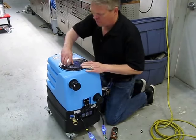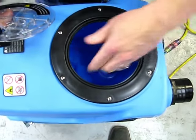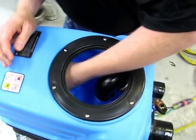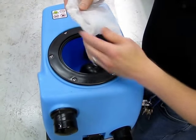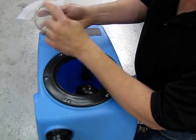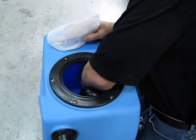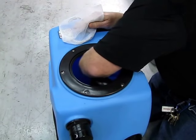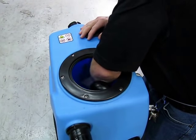On the inside I wanted to point out there is a ball and cage filter system in here. This would need to remain clean in order for this to operate. There are also two different filters in here — there's a lint sock for your auto pump out that you would need to lift out, and I can see that this is a steel ring just to give it some weight as it sits on the bottom of the machine, so this is obviously going to rust and probably have to be replaced. There's also another screen down here which you'd probably have to unthread if you wanted to rinse it out, but it's got a pretty large mesh so it's probably not really going to get clogged. You need to make sure you rinse this stuff out all the time.